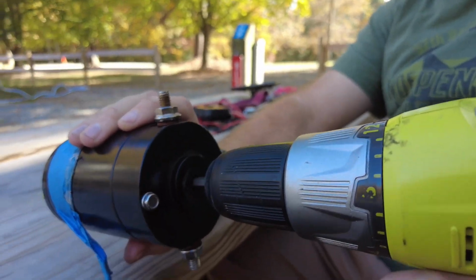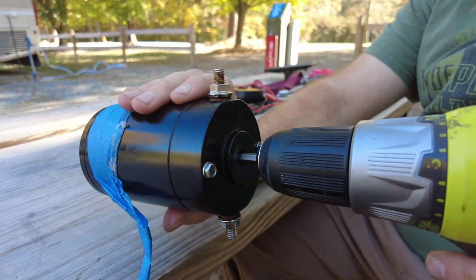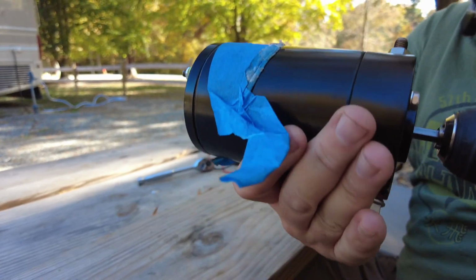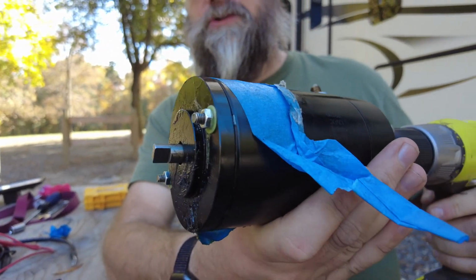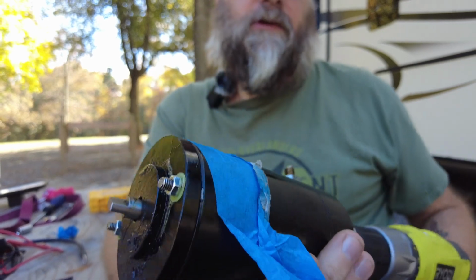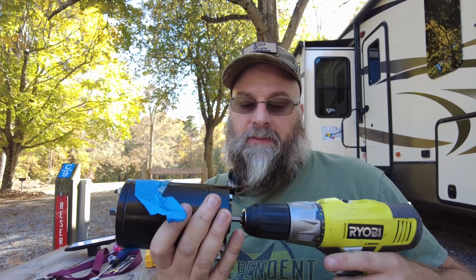And if you read the instructions, if you go clockwise, I believe, and we'll double check it, and I'll put a caption if I'm wrong, but clockwise will actually retract, pull in slides or retract landing gear. So if you do that and run it, you'll see that it runs the impeller. And then if I reverse it, it goes in the other direction. What we did was, somebody was either hitting the front or the rear landing jacks in manual mode, and then we just ran it the way we wanted to either put the jacks in or out. And then the same for the room slides.